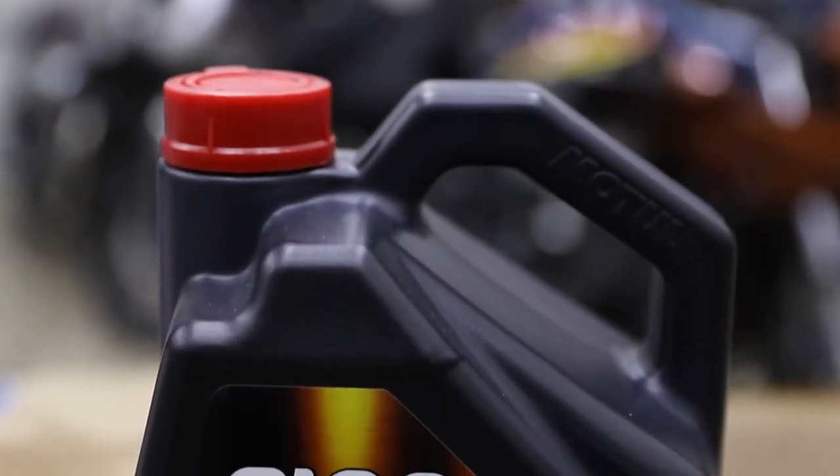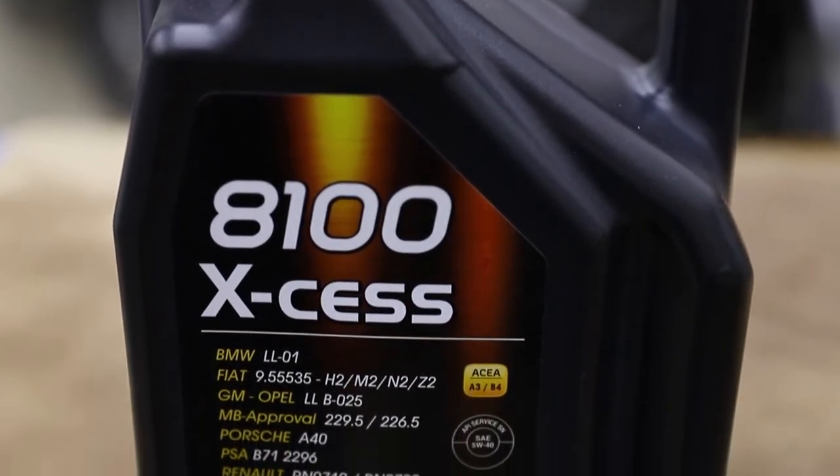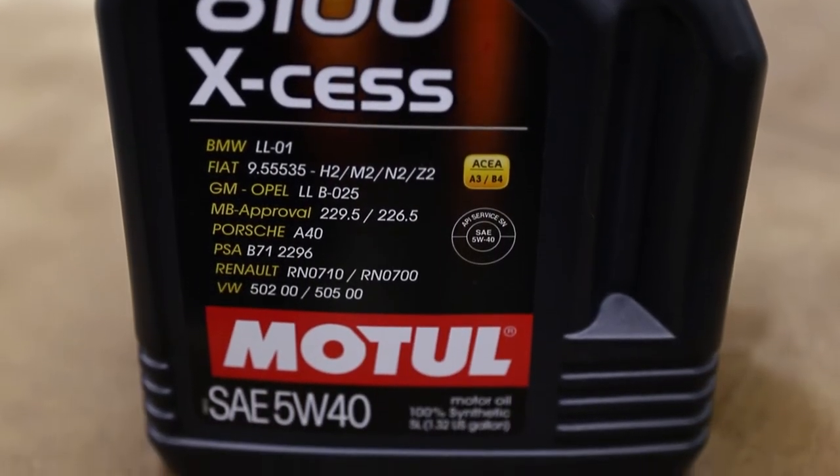That's part of why they had big wear marks on them from not constantly staying in contact with the cam. This also led me to change the oil. We've changed from 10W30 Pennzoil to 5W40 Motul. The 5W40 Motul is the same oil that I run in the SR240Z project. By lowering the first number and increasing the second number, you've changed the cold performance of the oil to function more like a thinner oil, and the hot performance to function more like a thicker oil. In the case of the Miata, it was suffering similar problems, so I believed the same solution would work, and it did. It's a lot quieter with this oil in there.